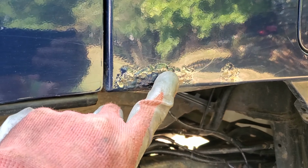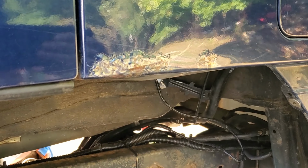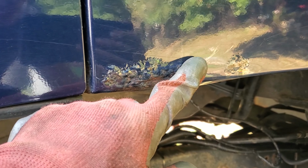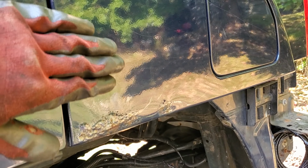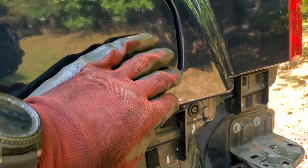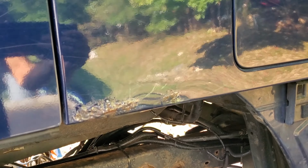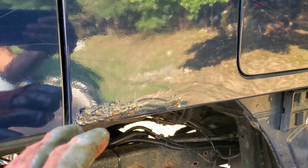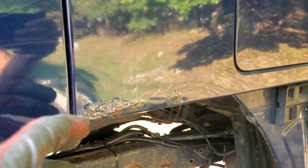And over here on the frame by the gas tank, I have this pretty bad spot actually. So since I'm working on a frame restoration, to prevent this from spreading anymore, I'm gonna sand this off. And I don't have this paint or anything. I'm gonna mask this off and paint it with black paint, the whole line over here. I mean, it's still better to have something slightly off, a different color, instead of rust going all the way across.